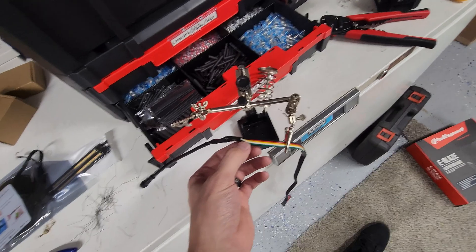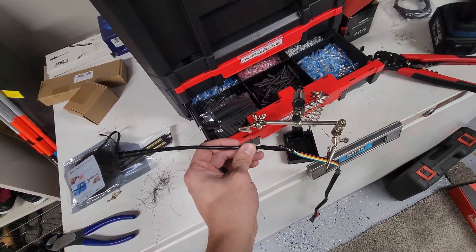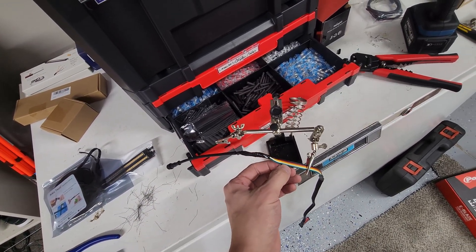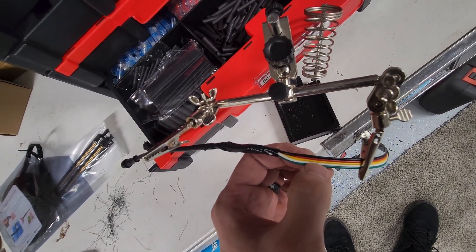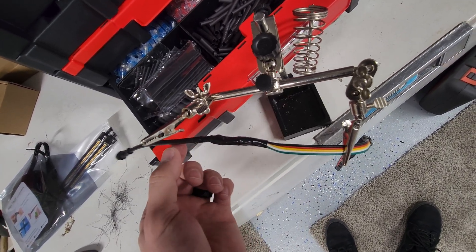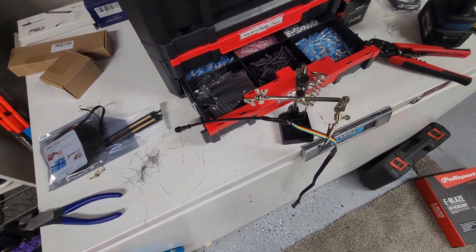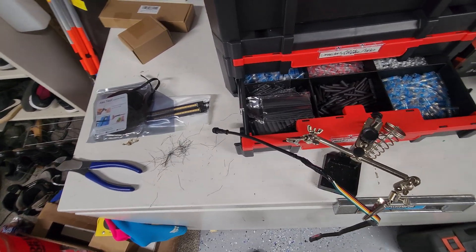For example, this connector — the wire for the brake light is blue on this because that's how I have it wired throughout the rest of the bike. But on the taillight, the bright red light for the brake light is white. So everything else is the same except for the blue one, which goes from blue to white. So it can be kind of hard to keep track of, so I would definitely suggest making your own wiring diagram or instructions or something of that effect.